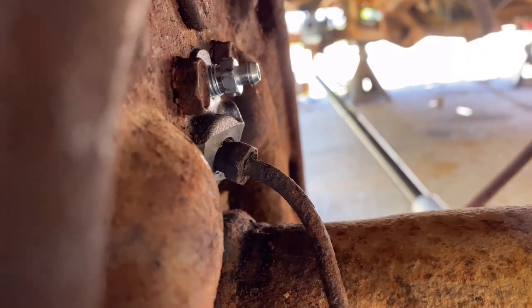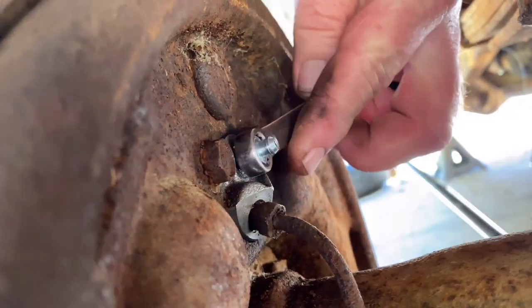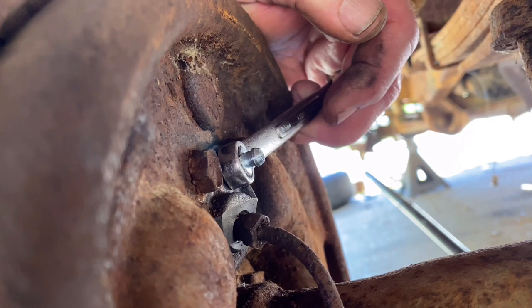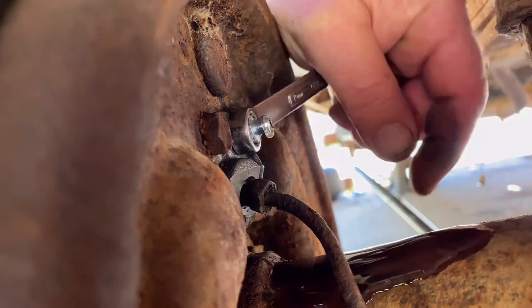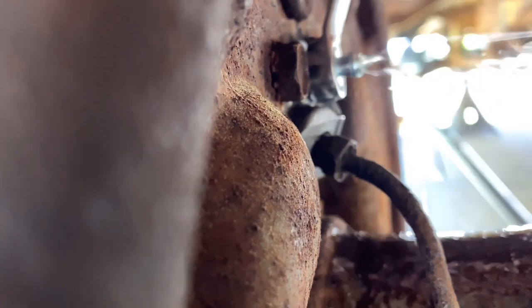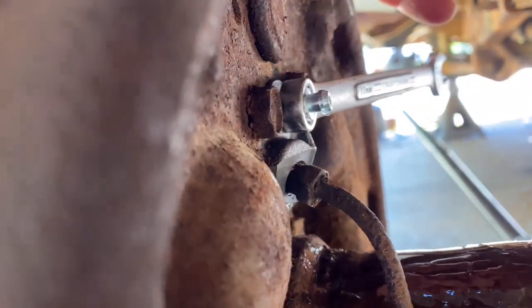Now we move over to the left rear, and it should not take as much for this side because we should have most of the air purged or all the air purged from the front to the back. All right, assistant, go ahead and begin pumping. After 10 strokes, you can hold. Okay, got a little bit of air. All right, do it again. All right, and one more time, and I think we'll be done with these. Saw no air that time. I think we're good on these.